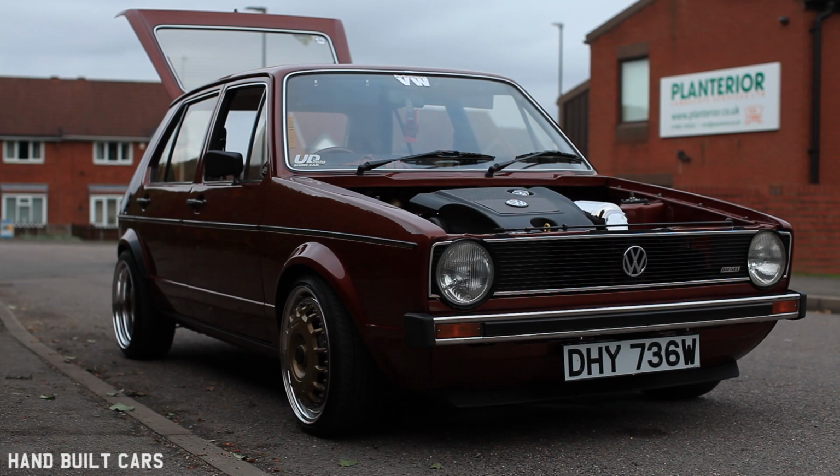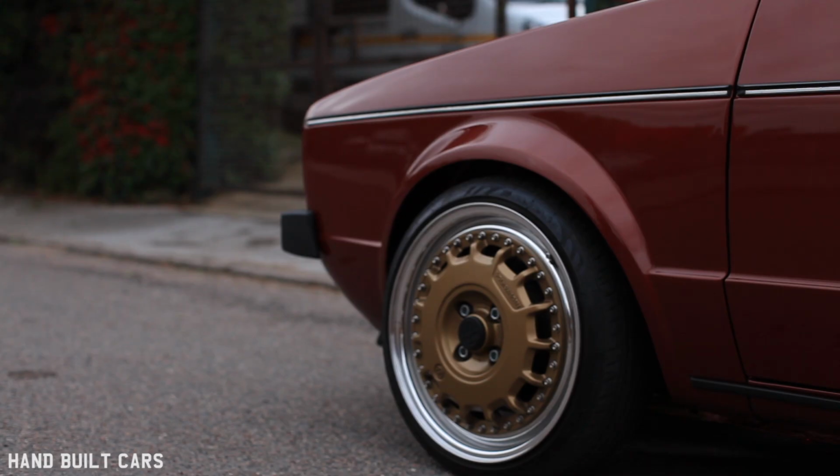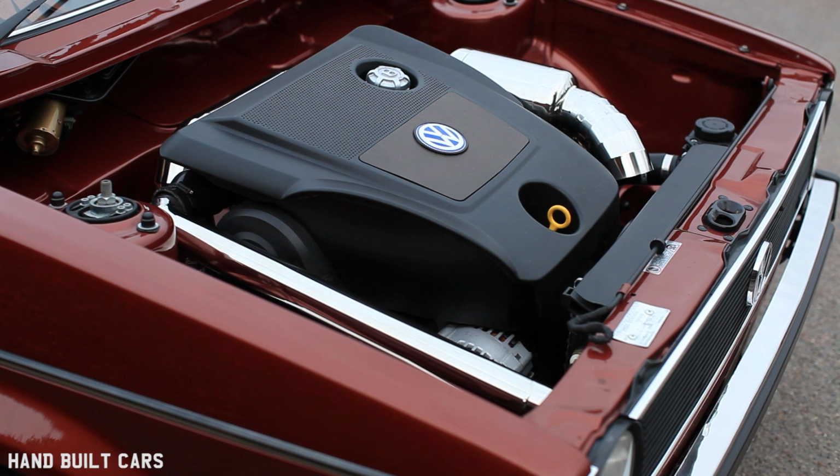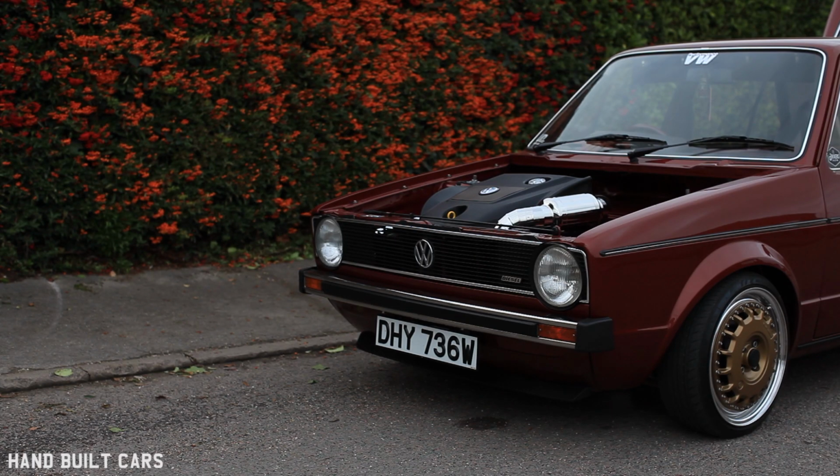It's had a full bare metal restoration: inner and outer arches, rear panel, front panel, pieces in the floor, pieces on the inner wings, then the full shaved bay with the turret raise, which allows the car to go as low as possible. Scuttle's been removed, heaters removed, battery relocated into the boot, remote servo behind the dash. A lot, it's had a lot.